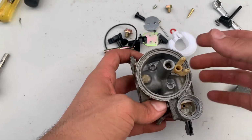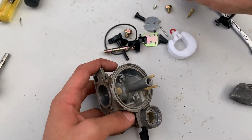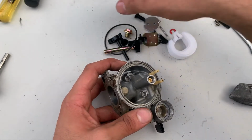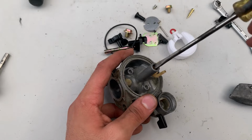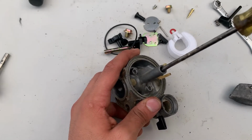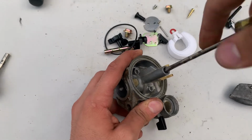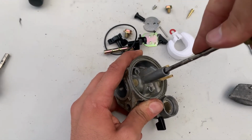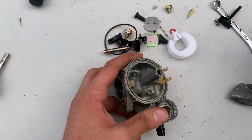First thing you're gonna put back in is the jet, the main jet, or the mixture jet, or something like that. I don't know what the exact name is, but put that part in, and then put this jet in and screw it down. Screw it tight enough, just hand tight. Don't go prying on that because you'll strip it out. Just small, like just till it budges.